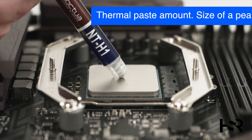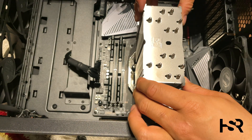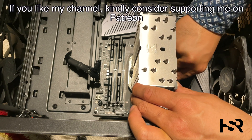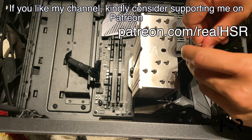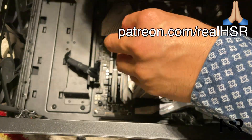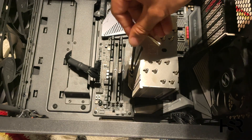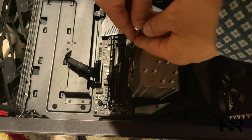Now we're going to put the cooler on. For thermal paste, I apply a pea-sized amount right in the middle. Then remove the fans by pulling the little metal clips on the sides and taking them off. When mounting the cooler, gently move it around a little if it doesn't seat right away — don't lift it off, just wiggle it slightly. Once it seats, don't screw one side all the way down; do a couple of turns on one side, then a couple on the other, alternating.